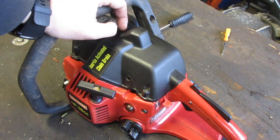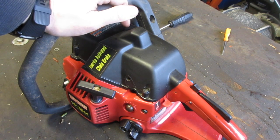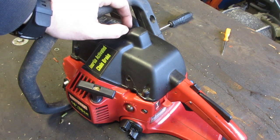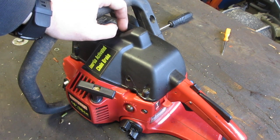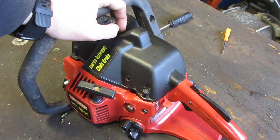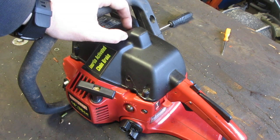and you instantly start revving it, now a couple high revs are fine just to get it going. That's completely okay. That's no problem. The real problem is when you first start it, instantly revving, instantly cutting, you are putting a lot of wear on your engine because your exhaust is warming up a whole lot faster than everything else around it. And more specifically, your rings are too.